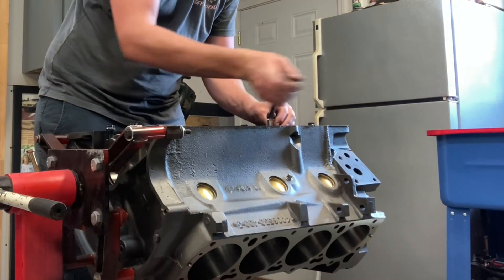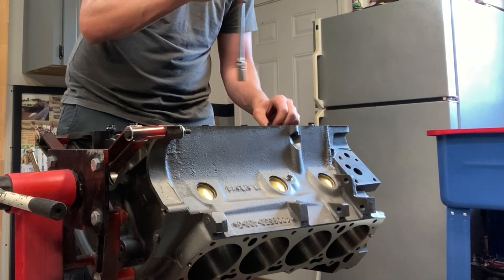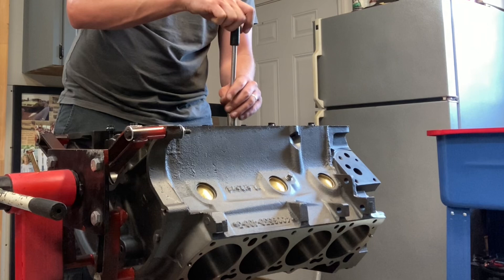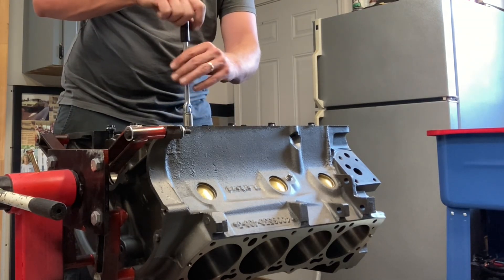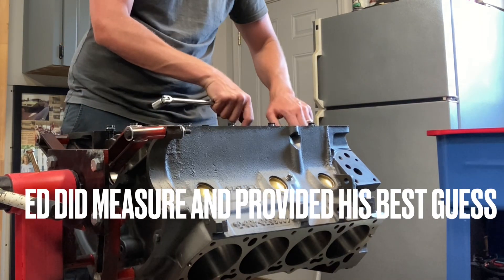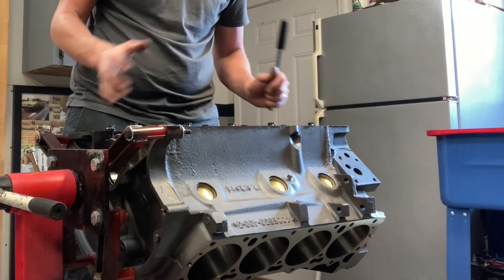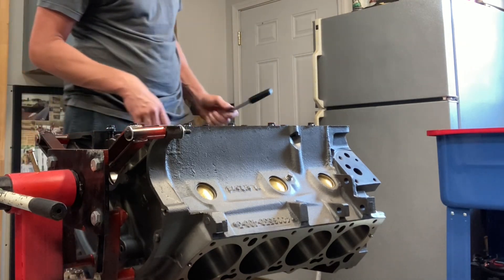The biggest comment I got about trying to make 500 horsepower is going to depend a lot on the compression ratio of this engine. What we have it figured as — which is just what it turned into with the pistons — is about 10 to 1. We'll know for sure today what that is. We never actually checked it at Ed's shop because I didn't have main bearings. So I got my main bearings here and I'm going to slap them in.